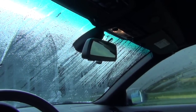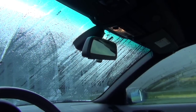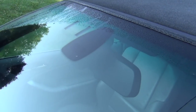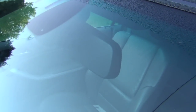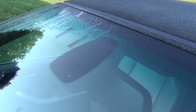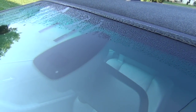The system communicates over the K-bus, or body bus, and the general module and the instrument cluster play a role in the functions of this rain light sensor. The rain light sensor is actually attached to the windshield, or at least a portion of it, and the electrical portion is behind the rear view mirror under the covers. The windshield has been replaced, but it is a Pilkington OEM glass, and this all looks good — there are no bubbles in the sensor.